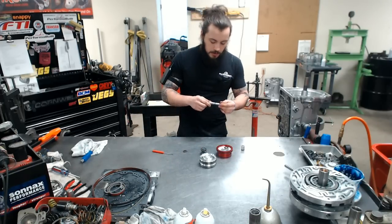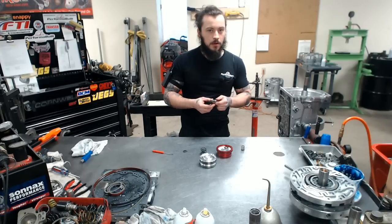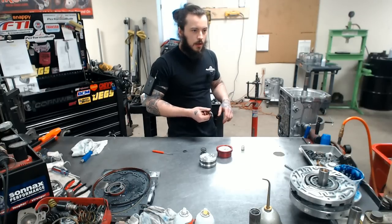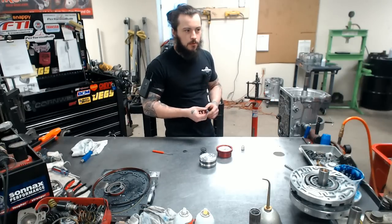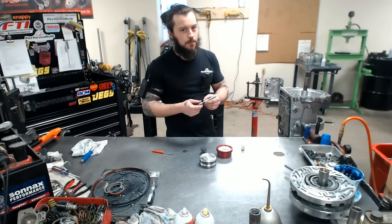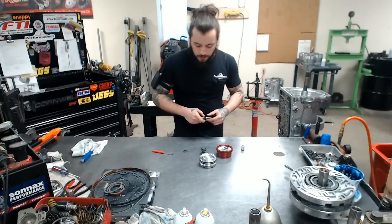And what I'm doing is I took the clip and everything off my Sonnax pin. This is another great item. If you have a heavily used case, or you've rebuilt your transmission like, I don't know, 5 times in the past 20 years, your bore might be a little worn out. But even if it isn't worn out, this is a great measure with these seals to keep it from wearing out altogether. And this will ensure an optimum band apply.